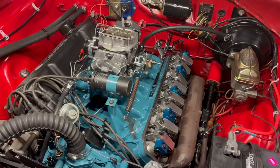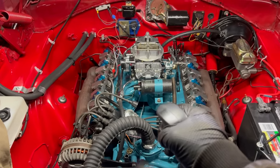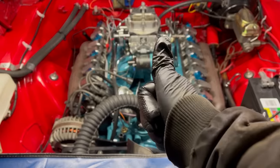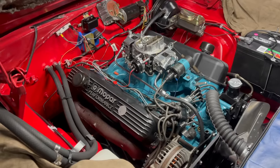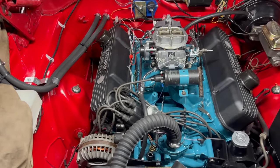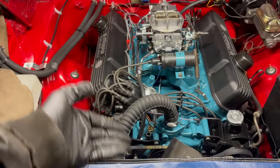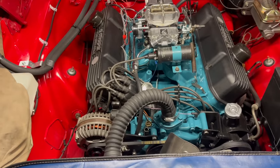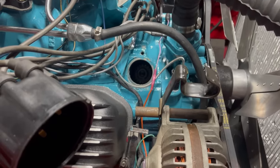Make sure the lock nuts are tight too. The studs in those adjustable rockers take two different Allen wrench sizes and I actually cannot find a proper fit for the larger ones — standard or metric. Now they're all adjusted and I'm curious if it will sound any different when it's cranking. Sounds more even. Let's go over to the other side and see what's what. Valve covers, coolant, fire — and maybe reconnect the coil wire for the seventh time. Back together, ready to party, except for two things: coolant and heater hoses, and I need to re-stab the distributor and drive gear. Pop the distributor out, aim that gear roughly front and back, slightly down, re-stab the distributor with it pointing at number one. Remember, the distributor rotation is counterclockwise, so when the rotor was way over there, extremely extremely retarded, there isn't enough room physically to crank the distributor to the point that it would be workable.